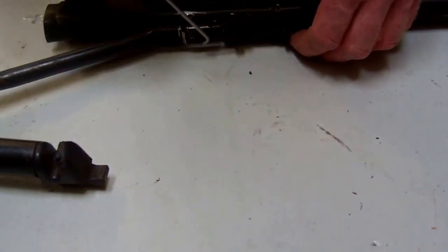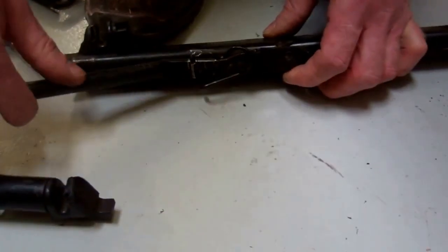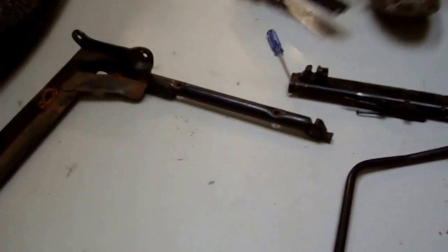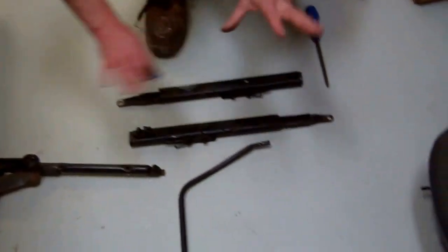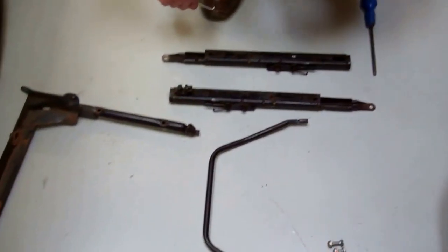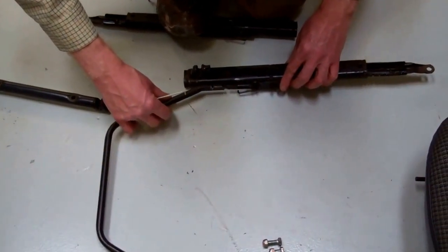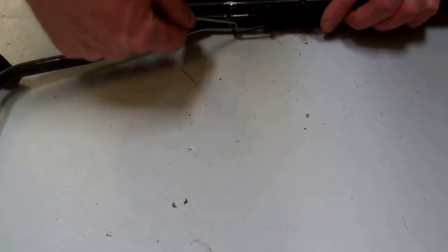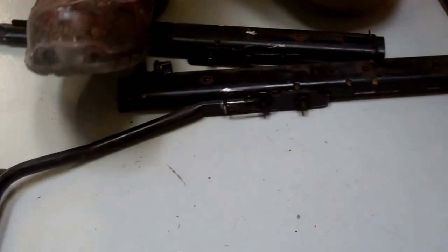And then the same thing happens on this side as well. If we can just pull it up. Probably as easy just to lever it out. There, okay. Right, okay, like so. So that is the seat in its various component parts. So you can service this, you can grease these up, you can recover your seats, and the reassembly should be self-explanatory. The only bit that'll be a bit tricky on the reassembly is doing this mechanism here. But again, the best way of doing that is just slot it over and then use this little hook tool I've got here just to sort of fish him up like that and just push him in. Okay, good luck with that.